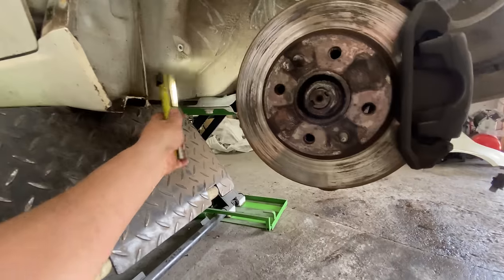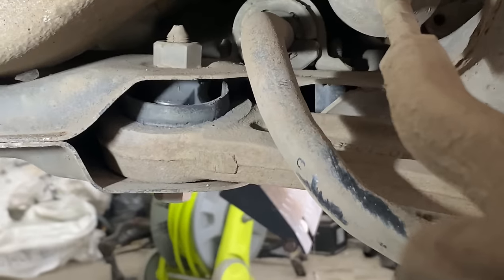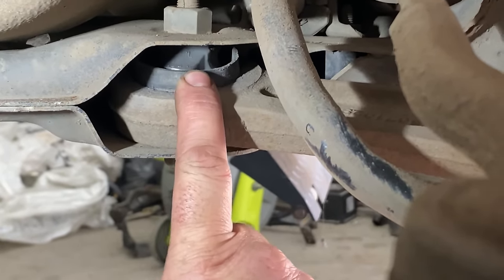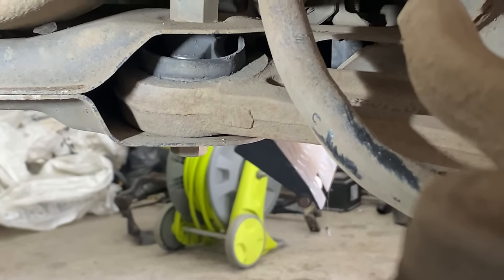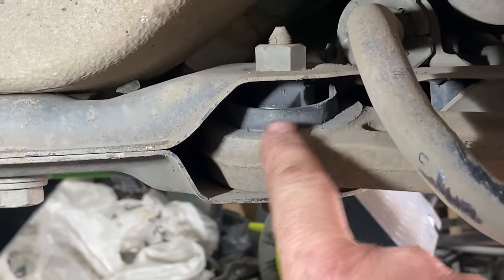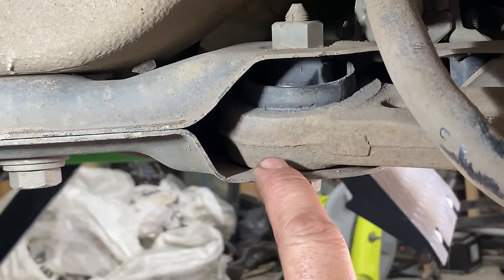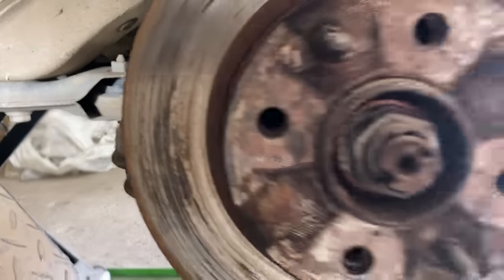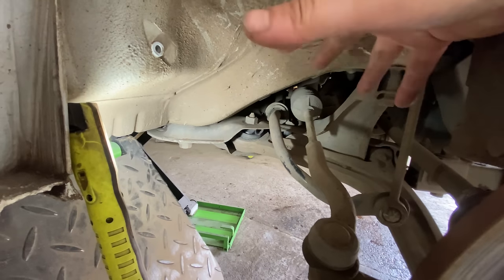But also, I've noticed this here, which is the lower... So can you see that this lower wishbone here, it's got this rubber. Sorry guys, I'm losing my words again. It's because I'm thinking about loads of bits and pieces, but this basically shouldn't be touching the bottom part. The metal piece in the middle of the rubber housing has dropped, and now it's going to be hitting and banging on this. So, was that part of the accident? Who knows? But anyway, I'm going to change the lower wishbone and get that done.